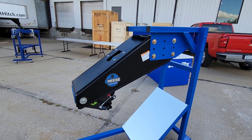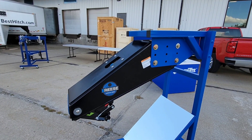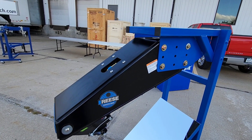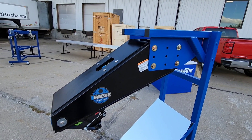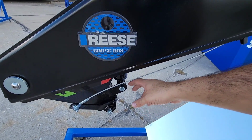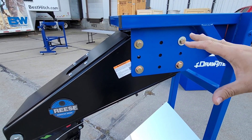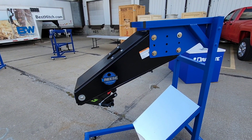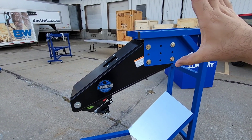When they came out with the second generation, it wasn't exactly a direct collaboration, but it was certainly inspired by feedback from my channel to include things that were just lacking. First of all, the air valve on the initial Gen 1 Goosebox — I'm not going to say it had problems, but it wasn't a favorite. It had a pressure relief valve that would sometimes get triggered when you'd hit big bumps and the airbag would compress. So they removed it and went to an entirely different valve placed in the back. They also added a locking mechanism and increased the height of the wings, raising them up so the unit could be dropped lower in the fifth wheel, making the fifth wheel nose ride a little higher.